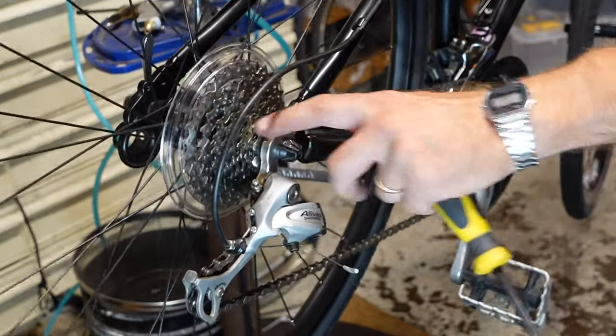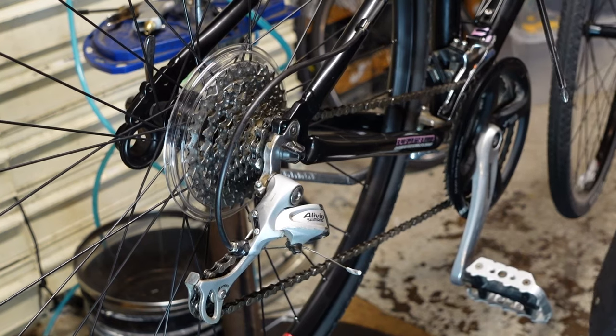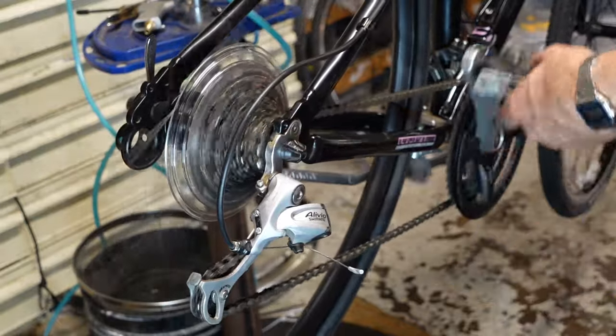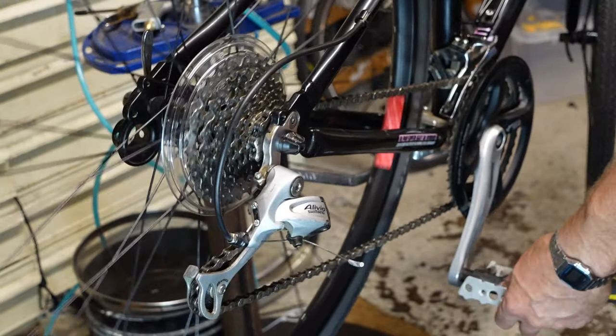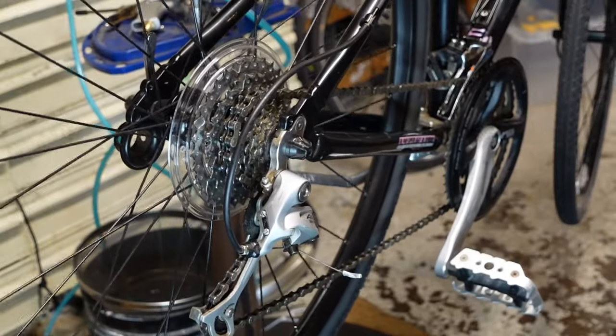And then I check the other extreme. And God, my spidey sense was really wrong about these brakes. I check the other extreme and I'm gonna loosen the cable just a smidge. So you don't want it rubbing there either. So now you can access all 8 speeds back here in that middle ring and it's not gonna make any noise.